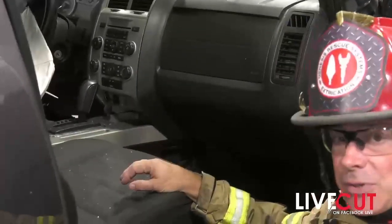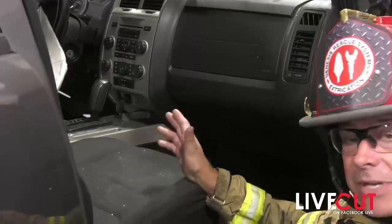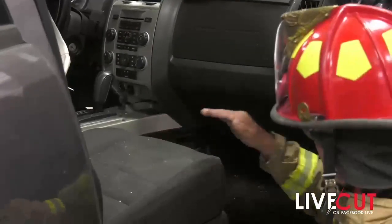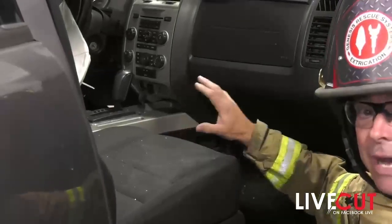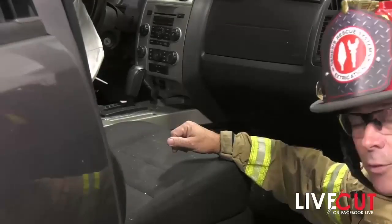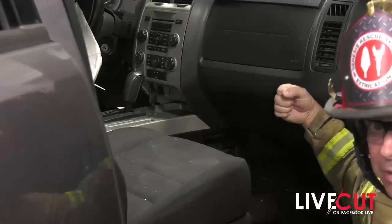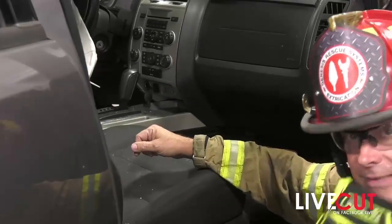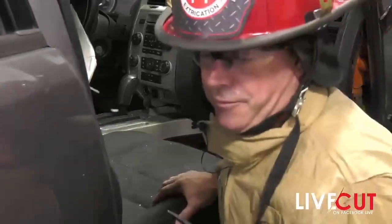Now, what I get all the time is, hey man, how am I supposed to do that if there's a patient in there? And the simple fact of the matter is, I can't tell you that. It depends on their condition and their position. You may have to come from this side, get your Sawzall out, and cut all the plastic crap out of your way so you can get to the actual steel itself. For whatever reason, a lot of firemen are loath to remove plastic. They'll make one cut, then they pull it aside, and it'll immediately flap back. If you're gonna take something out of a car, take it completely out of the car and get it gone completely. That's what we're shooting for.